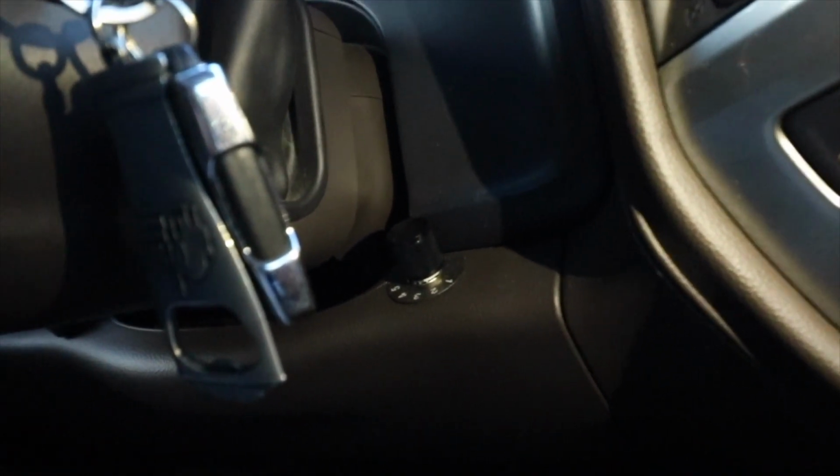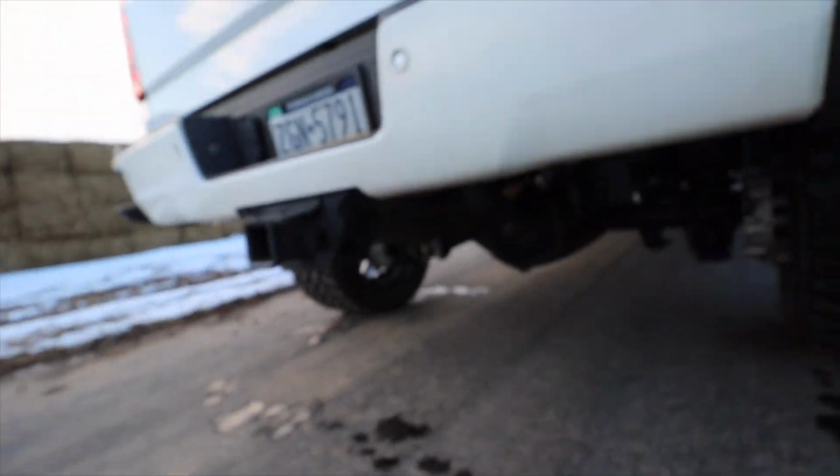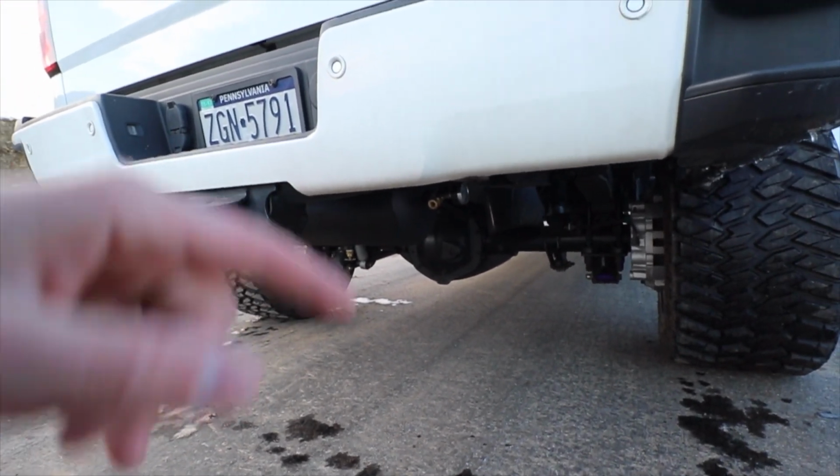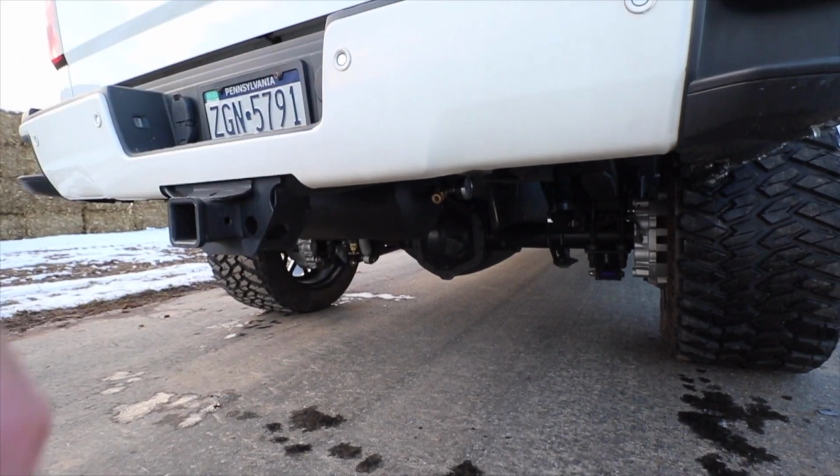That is through PPEI. And just to jump outside again real quick, you get a very unique exhaust note with a fixed vane turbo versus the stock turbo, which was a variable vane. I do really like interacting with the driving dynamic of a fixed vane turbo. Way different than a variable vane turbo because obviously it doesn't spool up as quickly, but it's nice just because from a mechanical perspective, it's a way simpler turbo, and there's really not much that could go wrong with it, versus when you introduce all the electronics of a variable vane turbo, you have a little bit more of a complex dynamic, if you will.